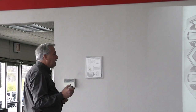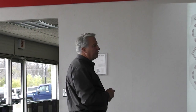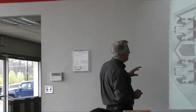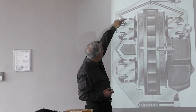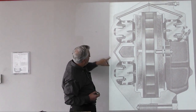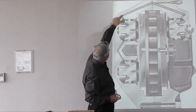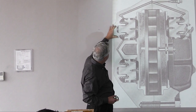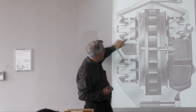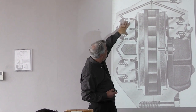What's unique about the Corvette design is the hydraulic seal — it's a lip seal. The brake fluid is introduced through the line, brought into the back of the bore pushing on the back of the piston. Here's where it's sealed, and out here is a dust boot — just a shield to keep crud from getting in there. As the pad wears, the piston moves forward in the bore, and this seal actually wipes the surface and moves forward.